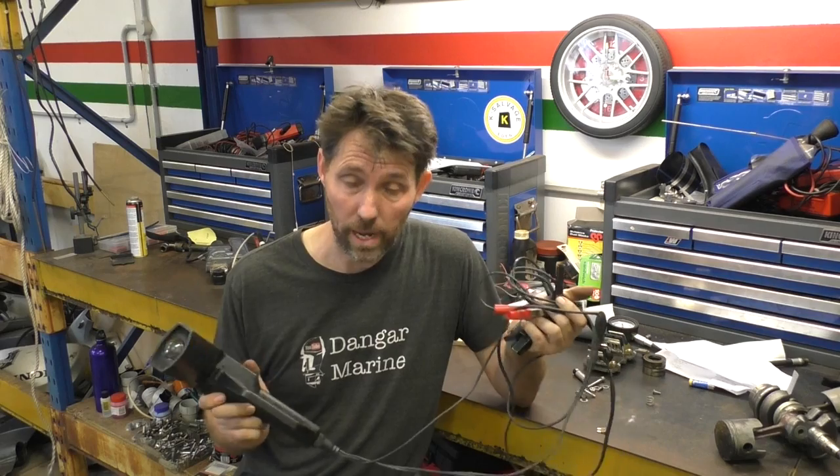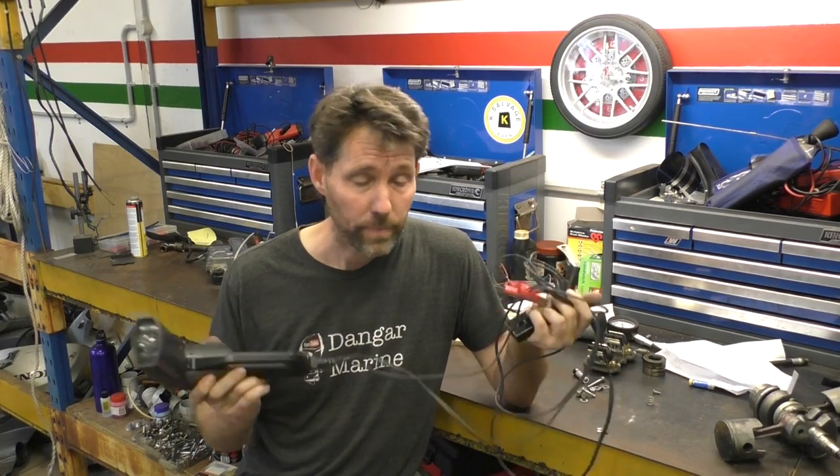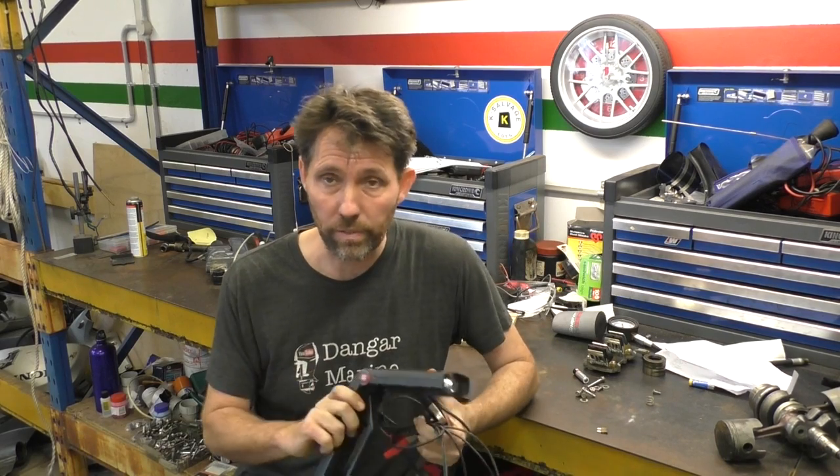As you can see, it was around about just over six degrees after top dead centre — within that seven plus or minus one degree range. Still backfiring and popping a bit, so I've got a feeling it's probably more a lean condition causing that. But at least we know our ignition timing for the idle is correct. They're pretty simple: three leads, point at the flywheel, find the marker, you're good to go.